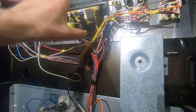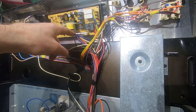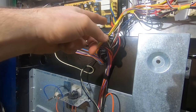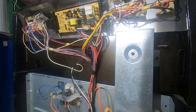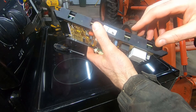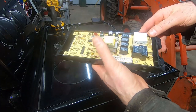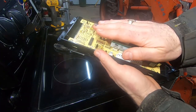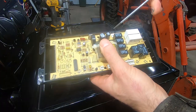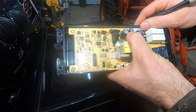I'm going to take this apart. There are four screws to take the control board out, and you'll need to disconnect the big connector and these wires. I'd always recommend taking a photograph to know how to put things back together, and certainly unplug the power before doing this. Be careful because this is a double circuit board — there's one circuit board here and another right behind it connected with flimsy little wires. You'll hinge it open, and there are little molded bumps in the plastic on the top and bottom that hold it in.